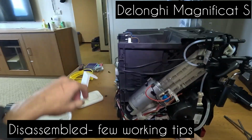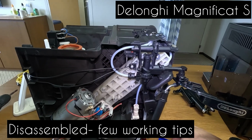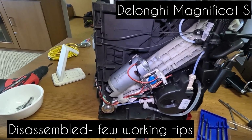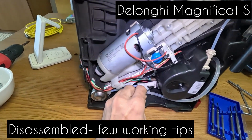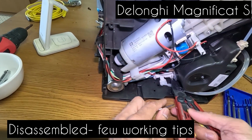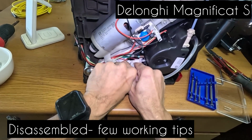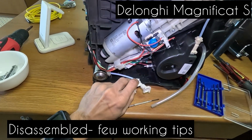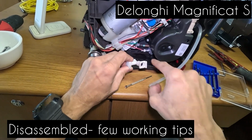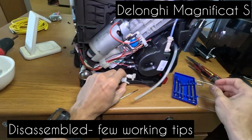And now to take off these pipes, you will need something like this, a pretty small tool, and a plier. So you carefully release these spring locks. Yes, you can pull out this hose and pull out this pipe. Remember, there may be a bit of water dripping through because there will be water in your resistance. There's a seal here, there's a seal there. You put this in. This is to lock the water coupling, the water pipes, in place.